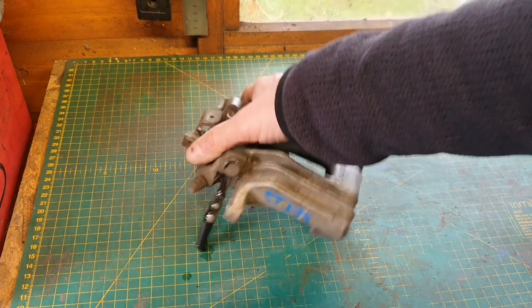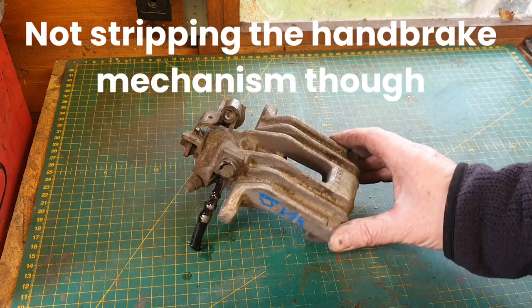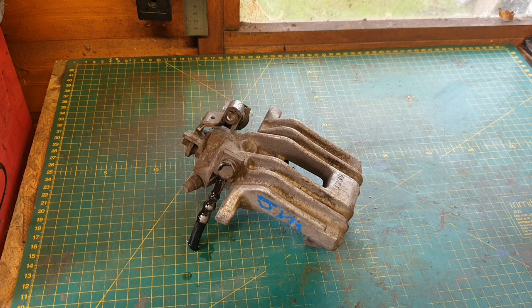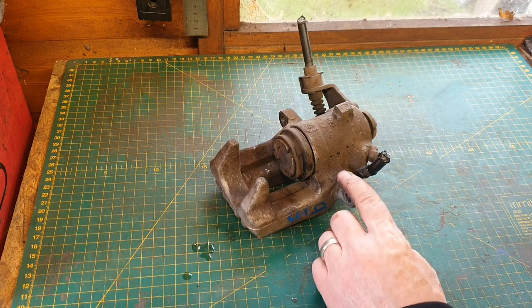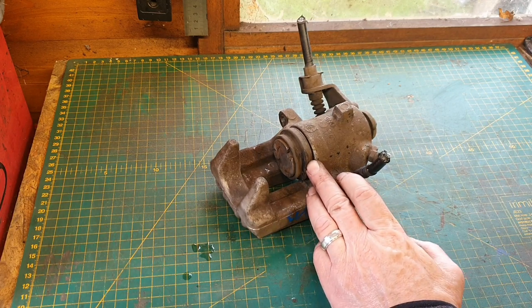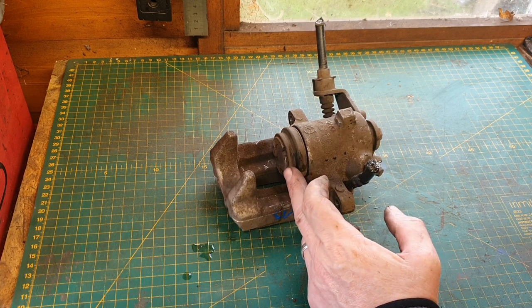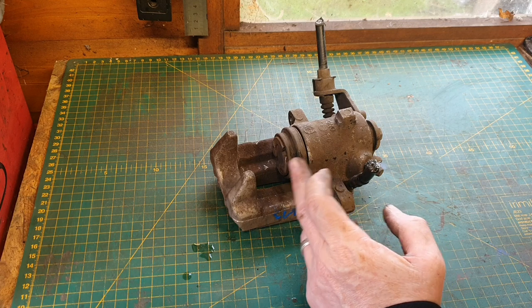Hello and welcome. I'm Alex and what I'm going to be doing today is a rebuild on a rear brake caliper off my 2006 Fabia VRS. These were commonly used on a lot of Volkswagen Audi Group cars, and a common problem with them is that the aluminium goes all furry, oxidises where the rubber boot seal is, and then it prevents the piston being moved back in, which is what happened to the one on my car.